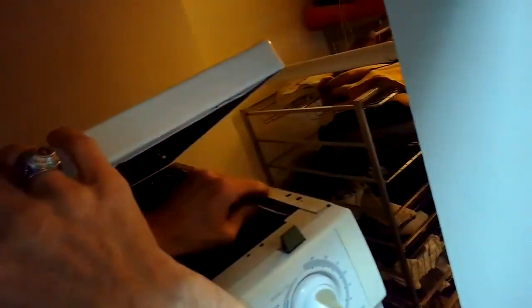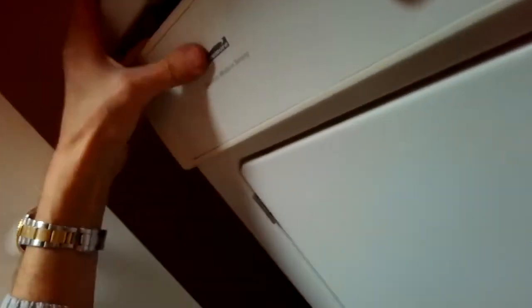I'm going to hook these cables back — there are two of them. They're modular cables that bring power to the front panel timer and send power back down to the motor and heater, so make sure those are secure. The problem with this dryer was no heat, and all the things we checked are common reasons why: a broken element, or a high limit or thermal fuse that's blown.